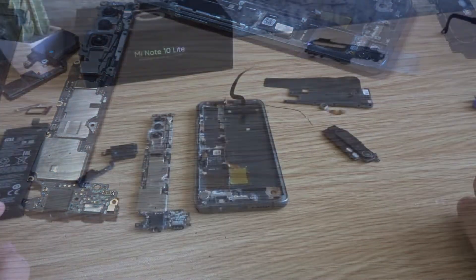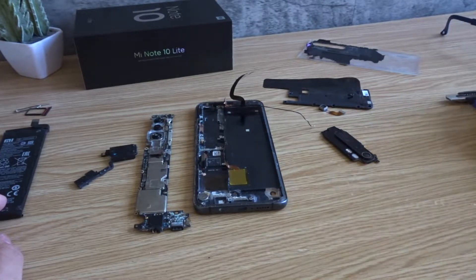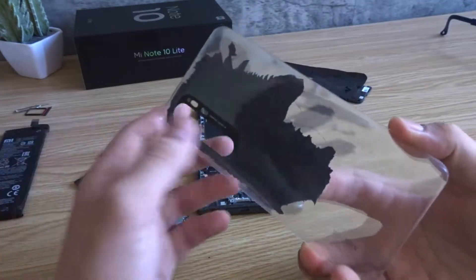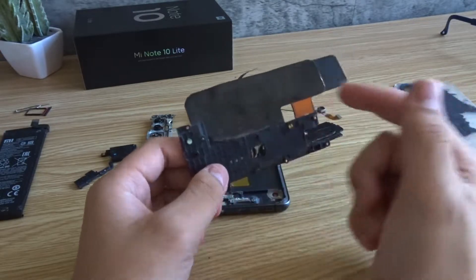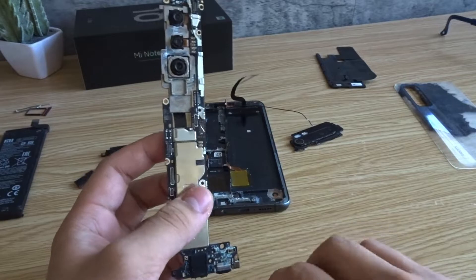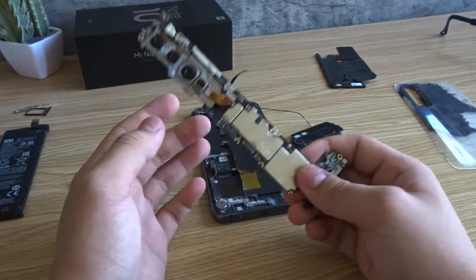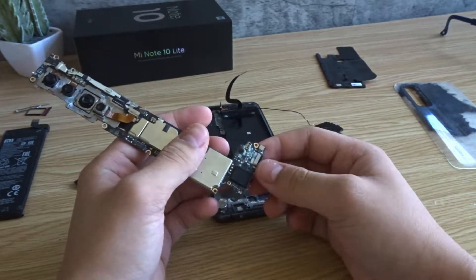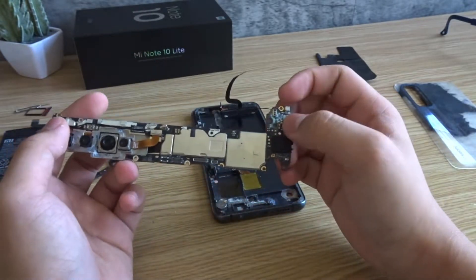Here's a quick look at all the components. I used the hairdryer, the knife, and this prying tool to open the phone, then screwdrivers. Here are all the pieces: the back glass which is now almost transparent — the gorilla glass — some plastic pieces, and an NFC tag. There's also this camera module. This is the main board and the only board on this phone. Many other phones have separate boards — for example, Apple's iPhone has a separate charging board so if it breaks you can replace just that. But with this Xiaomi phone everything is on one board, so if something breaks you essentially have to buy a new phone.